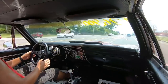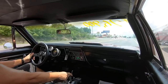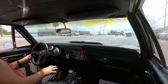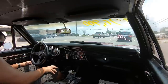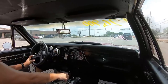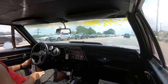So far so good, shifting through all the gears. Let's hit the brakes and see how they react — brakes are stopping fast on this one. Oil pressure's at 50, engine temperature is still sitting right at 200, which is okay. Like I said, there's a couple switches below the dash too. I just want to make sure the electric fan's on when we get up there and double-check on that. It seems to be working pretty good — the engine temperature just pulled back down to 180. The thermostat opened up, cooled back off — it's working good.